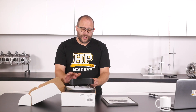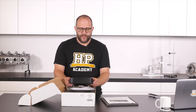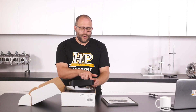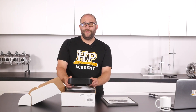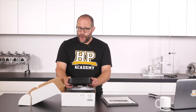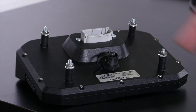The shift LEDs are located above the screen, and there's a warning LED on the left and an alarm LED on the right. The colours of these LEDs are fixed, so the shift LEDs come up in a two green, two yellow, three blue arrangement. The warning LED is yellow and the alarm LED is red. It would have been nice to see AEM use RGB LEDs so we could configure the colours for our application, but they have let us configure the brightness of all the LEDs, and they've put nice diffuse lenses on them, so you should be able to see them easily without them being too glary.